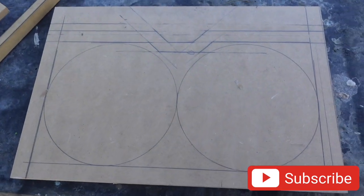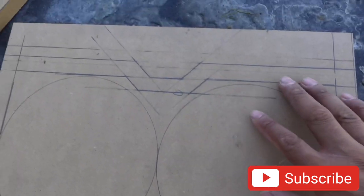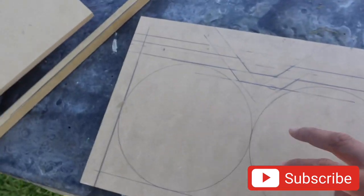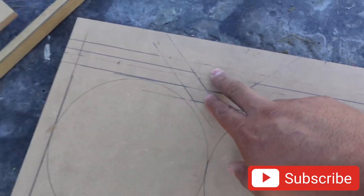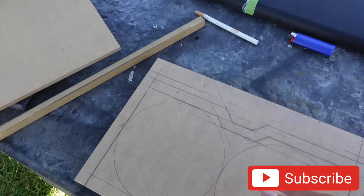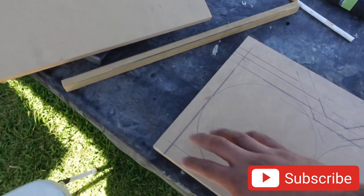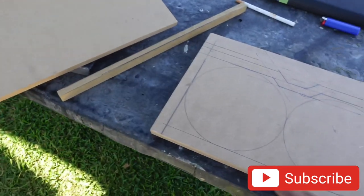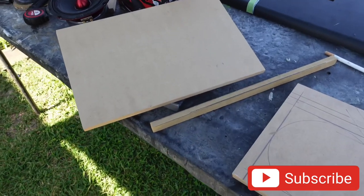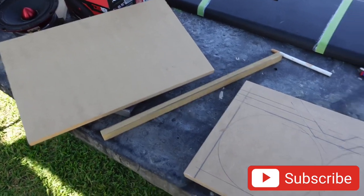So this is the ring we're going to cut out — I got stuff drawn out. I'm going to run the table saw through this line right there, chop that one so they're both perfect, then cut out the V-shape in the middle, trace it onto that side, and trace out what's going on onto the other piece — because this one I can use as the template for the plexiglass and use that one as the actual ring. I already have the template cut out, which saves a lot of work when it's time to install everything. Let's give it a shot.